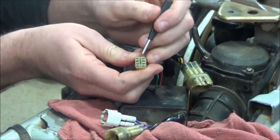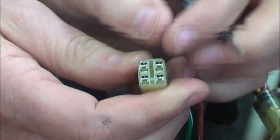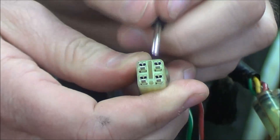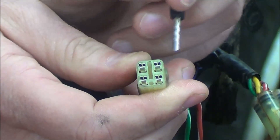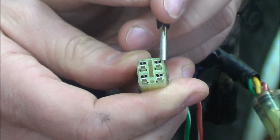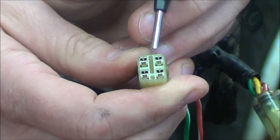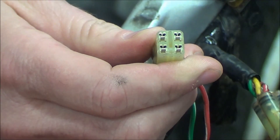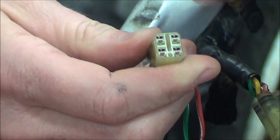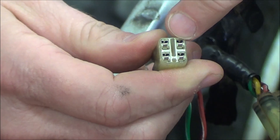And then it doesn't cause any damage. What we don't want to do is be wedging into these connectors, because then what they end up doing is splitting it apart. And if I make this wider than it was designed, what's going to happen to the male connector that I'm trying to put in there? It's going to be loose, and you're going to have a voltage drop and a higher resistance — you're going to have all those things. So sometimes what we do is we put paper clips in here, and what I do is I take the appropriate pins.